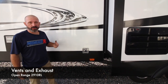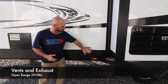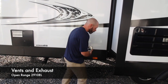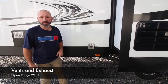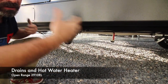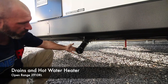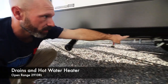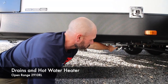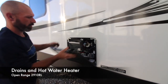Right here is your heater exhaust. In the winter time when you're running the heater, this is where the hot air comes out — make sure there are no tables, chairs, or anything that could melt nearby. Most importantly, remember that's carbon monoxide coming out here, very dangerous. These two lines are your low-point drains: if it's going to get cold, dump all your tanks and pull those caps to drain your lines. Here's where you hook up your sewer — you have a gray and a black valve. Make sure your black is never left open dry; you can pull your grays and let those dump all weekend long.